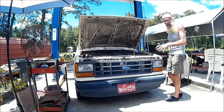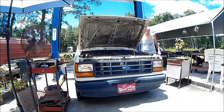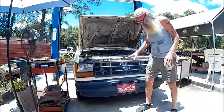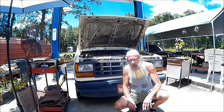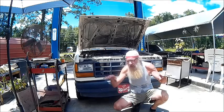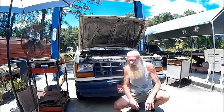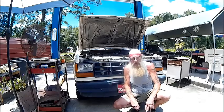I tested the lights before I put everything together, but you do want to test the lights. You want to make sure you got your high beam, your turn signals, running lights, and all that. Also don't forget that you're probably going to need a headlight alignment on these. If you know how to do that with a garage door — it's 15 feet back, four-foot height level, and the left side is down under, right side is middle of line. If memory serves me right — I used to use the machine — I haven't used the garage method in a long time. They don't charge a lot to align headlights, especially on one of these.